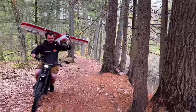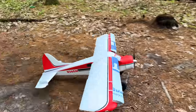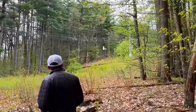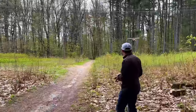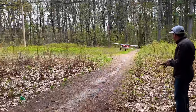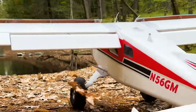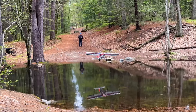While you watched some bush flying, ultimately, Ben and I noted that despite the slots and other aerodynamic band-aids we added to the plane, making turns at high angles of attack with the Stol Beaver was always easier if we unloaded the wings slightly with some down elevator while giving aileron and rudder inputs. This ensured that we had good, attached air over the top of the ailerons, especially at high angles of attack throughout the turns. We have no definitive way to prove this, but it worked for us.